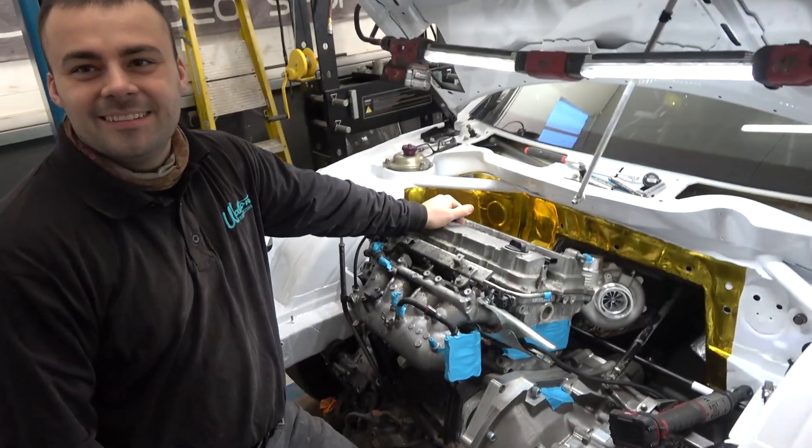This has got an engine out of a Mitsubishi Evo 10 - probably not what these cars came with. This is an R5 car, which is a fairly serious rally car. As you can see it's a proper build. The size of this suspension, the seats will be mounted really far back in the car, a nice sequential shifter. It's come to us to build a manifold to suit a G25-550 turbo which you can see down there. We're also going to fit fresh air antilag valves on this car.